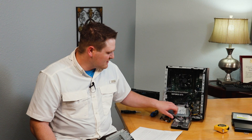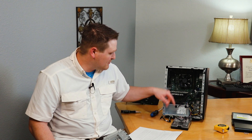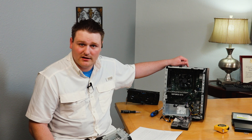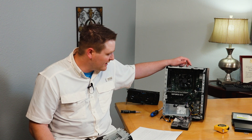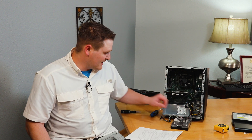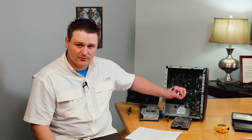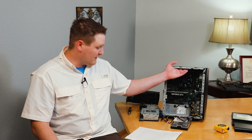About the power supply: some of the lower models come with the 310 watt power supply, but if you have an i3 with a graphics card you're going to have the 400 watt power supply. Most 690s with any i-series CPU will have the 400 watt. They do not label it on the box, so you can take the case off — there's one screw in the back — and just look at the unit. I'll have a link for a SATA extension cable in the description below if you want to position your SSD elsewhere in the case.